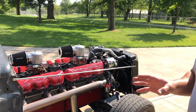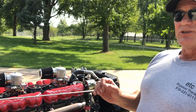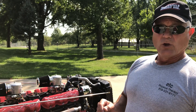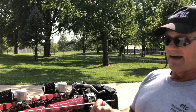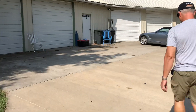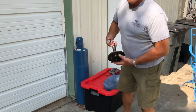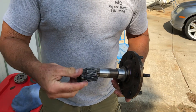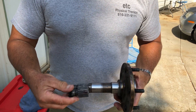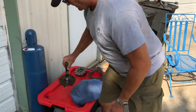Since the first video when the car first moved, we had an issue with the transmission. It seemed like the torque converter wasn't really hooking up, and then it would suddenly engage at about 1,500–1,800 RPM, which was too much torque for the drive axles we had. These are the Corvette stubs — this is what it did to the first set of stubs when we put it in first gear and stepped on the gas. You'd think it would simply spin the tires, but it got traction and sheared both of them off. So we had some 4140s made up to cure that problem.